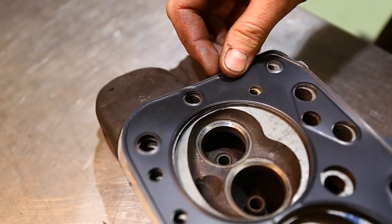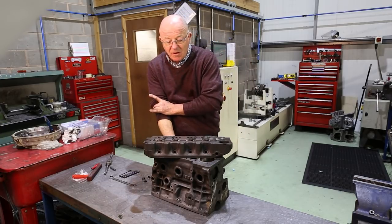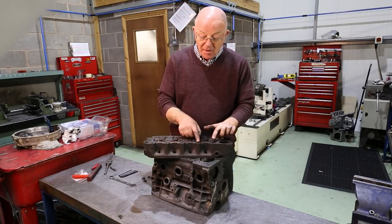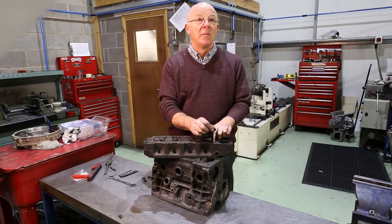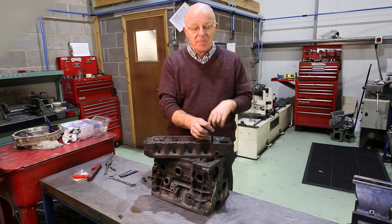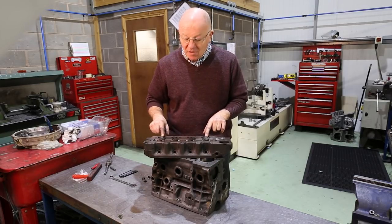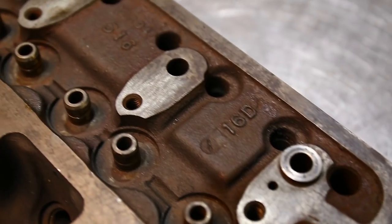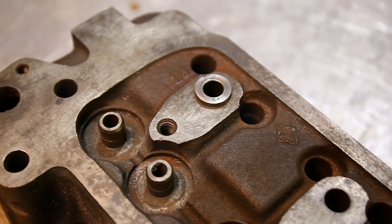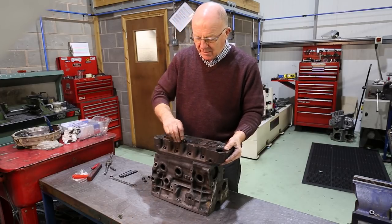All the head gaskets come for 11 stud and 9 stud. So you can use any BK450 or a Cometic. We've got here an original 1275 11 stud head. What you'll find is the standard head stud holes are very, very sloppy — this is so all the heads fit on all the blocks because of Rover's bad machining tolerances. But what they did do, this one they made as a dowel fit, so it's a lot tighter fit. We use that one as the datum. These ones that were originally baggy fit, we've actually made some little top hat sleeves that fit in here that now make them dowel fit — so it kind of triangulates: one, two, three. There's your triangle. So once those three are in, it's perfect.